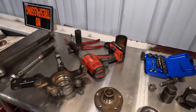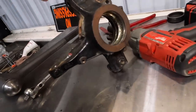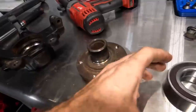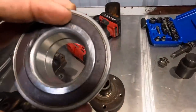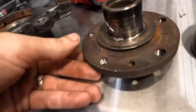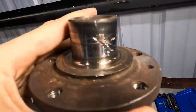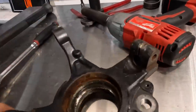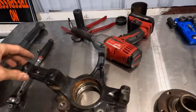What we're working on today is actually not a car — we're on kind of a side quest. My neighbor was attempting to do a wheel bearing on this front spindle, I think this is for like a Hyundai or something. They couldn't get the outer race of this hub bearing pressed out. I've got a new one right here — we can see it's got an inner race, there's a seal, there's our outer race, and there's a magnet in here somewhere that's supposed to pick up on the wheel speed sensor right here.